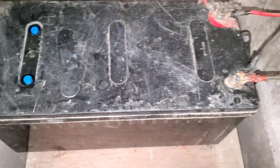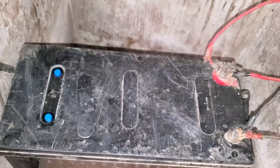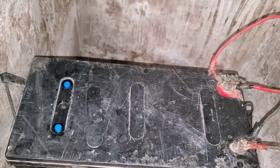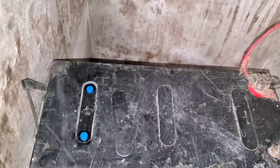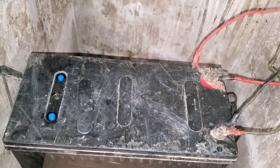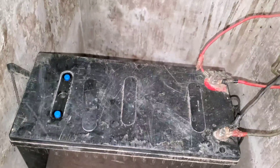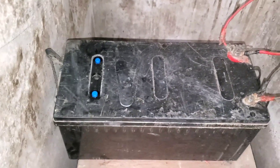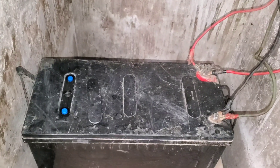Yesterday evening when I touched the sides of the battery they were warm, which meant a chemical reaction was happening — that was a positive thing, warmth across the cells. When we took the charge off, the battery was at about 11 volts, then it settled at 8.5 to 8.6 volts in the evening. So it improved from seven-point-something volts to eight-point-something volts.